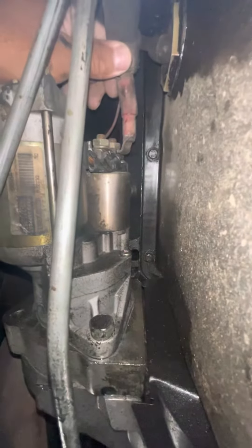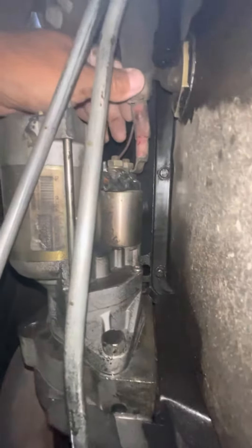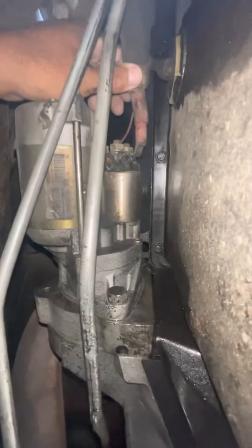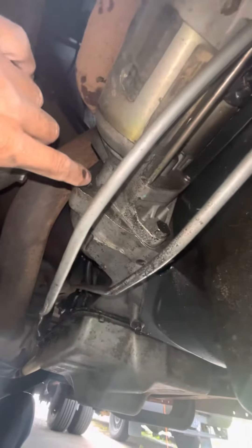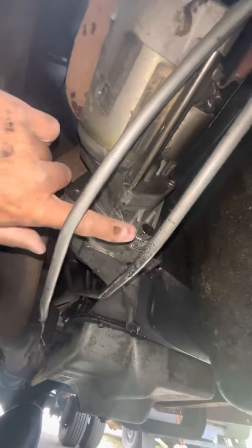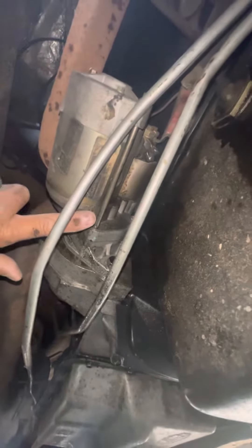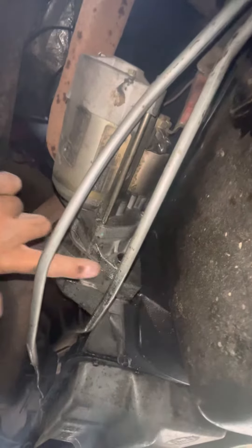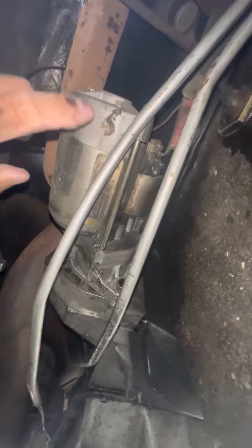That's definitely not good. I didn't expect to film anything down here because it's just two bolts. But besides that, I never knew that the stock original starter was a three-bolt, and you could put a two-bolt version on here — and that's what's on here right now. It's a two-bolt version, like the gear reduction, offset with one bolt here and one on the top. And that's the difference.